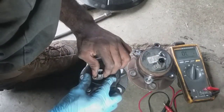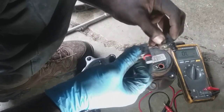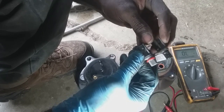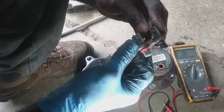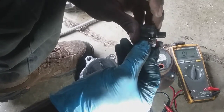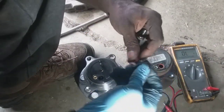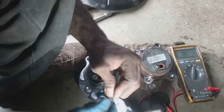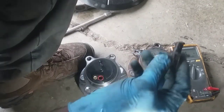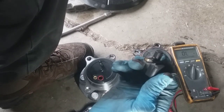I got the retaining bolts out. If we look at the sensors, they look identical. The connector is going to be the same length, same dimensions, same distance — all that's going to be the same. The only difference is the resistance value. I put this O-ring on there. I'm pretty sure this voids the warranty, but if anything does happen, I can simply put the sensor back on and return it. But keep your old sensor — if the sensor does go bad, you'll need it.